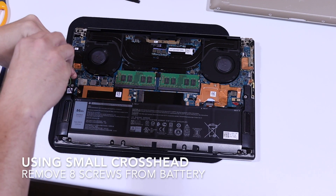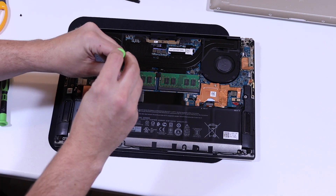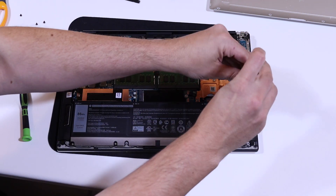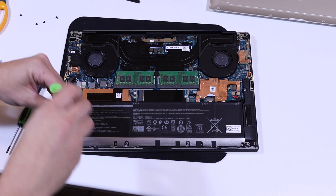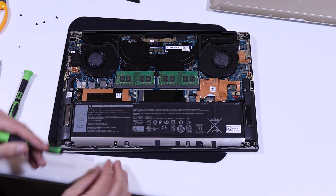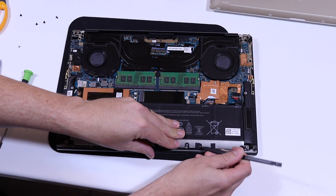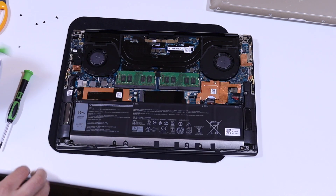Once inside we need to remove the battery — again quite a straightforward process. Eight screws, four on the top and four on the bottom to remove, and you need to unplug the battery connector, as you see me doing now. Also, there is a speaker cable taped to the base of the battery so you need to be very careful. Rather than lifting the battery out of the machine, I rotated it 180 degrees and placed it flat on the desk the other side of the laptop. This kept the cable in place so I didn't have to remove all the tape from the battery itself.